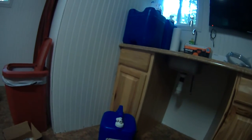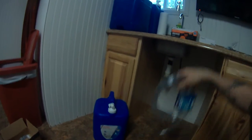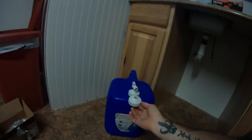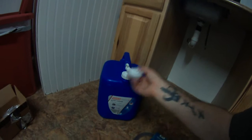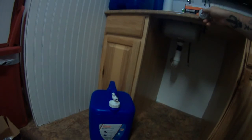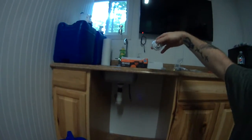From there, a little hose will go down into this Coleman water carrier. I'm going to get bigger containers, but for now I have this. I took one of these bottle necks and sawed the neck off so basically it looks like this — my hose will fit down in here, a perfectly snug fit, and the hose will go to the bottom so the strainer will pull water up into the pump and up to the faucet. When you turn the handle on, water comes out; when you turn it off, the pump shuts off.